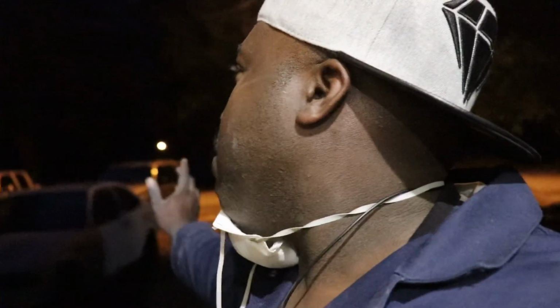Well, guys, I didn't make it. Look at that, it's dark. So the shed is lit up. Not as bright as I would like, but it's not bad. Anyway, so what I have to do now is wipe the car down. Once the car is completely wiped down, I'm debating if I wanna hit it with the adhesion promoter on the plastic trim pieces that are gonna be painted to match the car. And from there, I can prime those spots that need to be primed, and I will use my phone as a light. And from there, we will be done for tonight.